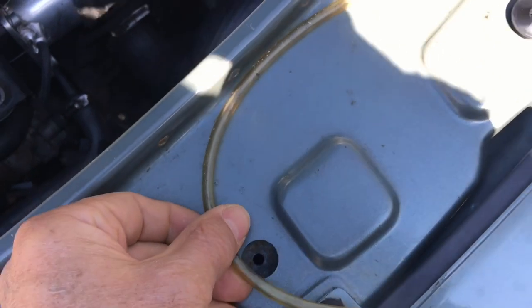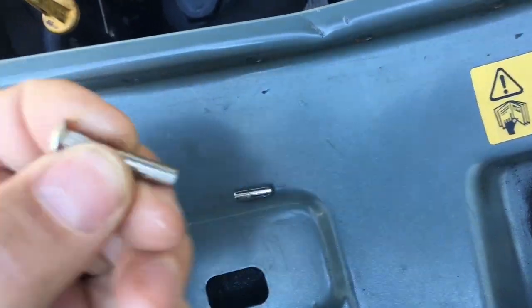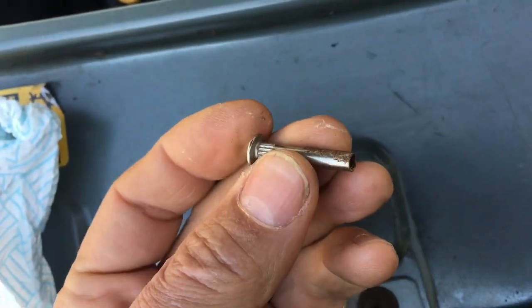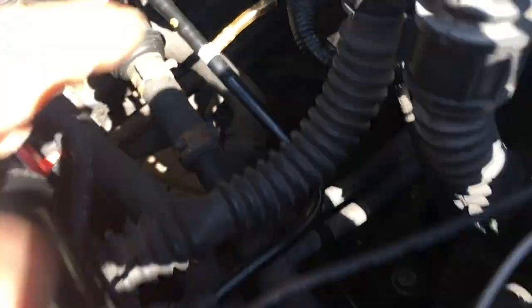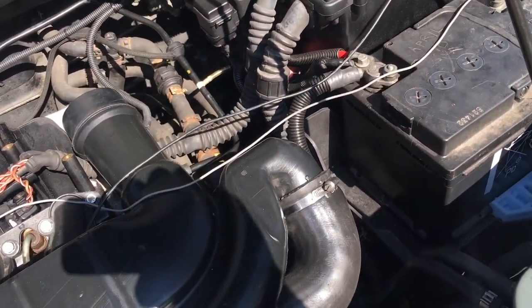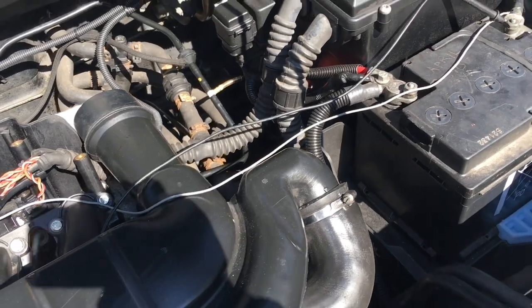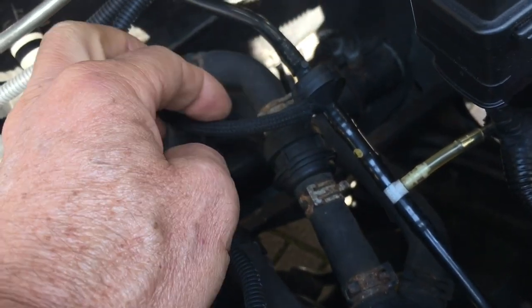You might need to attach an extra long bit of tubing. I found little bits of metal useful to join two bits of tube together — I cut one from a screw bolt for connecting kitchen units, which also serves as a useful blanking piece for the T-junction where the EGR was. I found that tube going off the EGR was a little bit leaky. To test, suck on the end of the tube with your tongue over it and test how long the vacuum lasts. If the vacuum disappears, you'll notice it's no longer attached to your tongue.